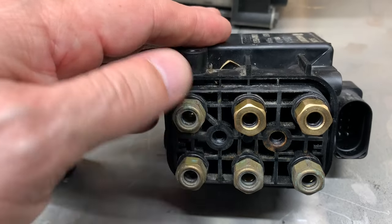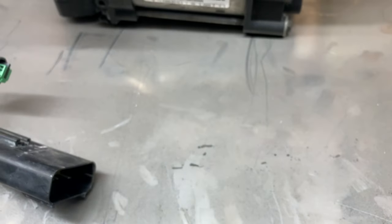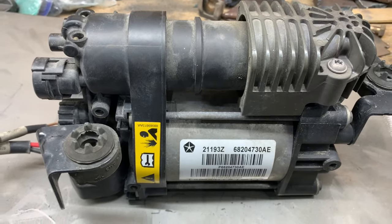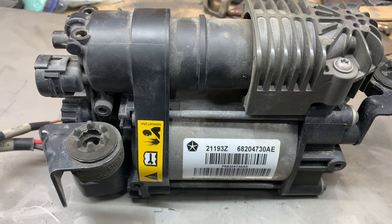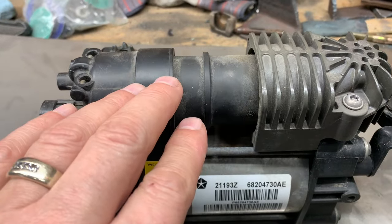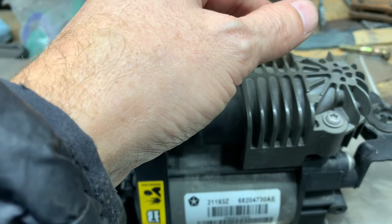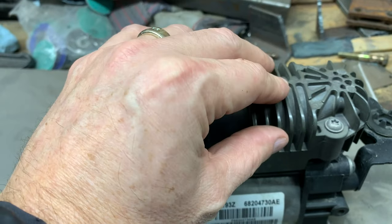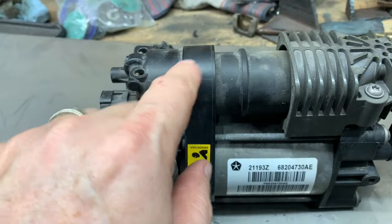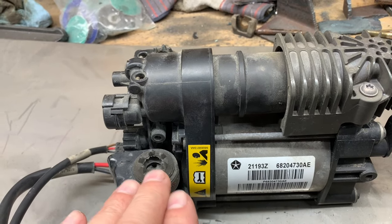I had to move on to something else and figure it out. What I figured out was the valve block was not the problem - this pump was the problem. I didn't quite understand that because the pump would run and run and it wouldn't go up or down, so I thought the valve block was the problem. But in reality, this pump has a reversing valve in it. It will pump air and the valve will go one way or the other depending on if it's trying to fill the tank or fill the bags. That was my problem - this valve wouldn't allow the pump to put pressure back in the tank; it would only allow it to put pressure in the bags.